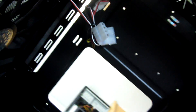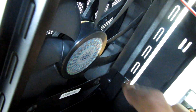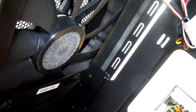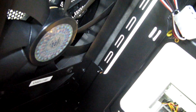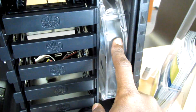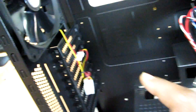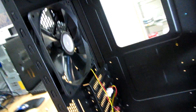I'm going to remove the top fan to mount the Corsair H100 hydro cooler with its two included fans — the radiator and fans will sit there. For airflow circulation, we have a front fan blowing air in, a back fan blowing air out, and the top fans as well, giving us correct air circulation throughout the case.